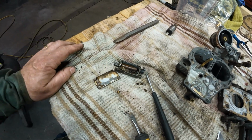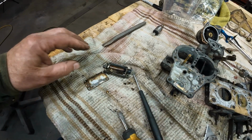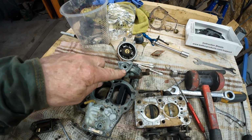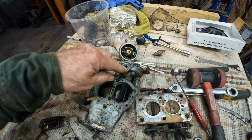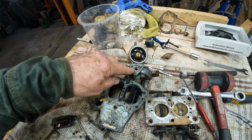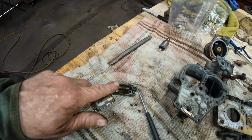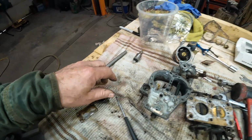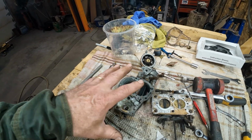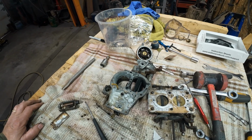And it's like an auxiliary air valve, I guess. It allows more air to flow through, or maybe it allows air to flow through to this thing here, and then this thing opens. When the motor's cold, this thing won't pull on the vacuum, but when it warms up, then air comes through that valve, makes this vacuum, and that will open the choke before the carburetor gets all hot, because it's way at the top end of the carburetor and doesn't get much heat there.